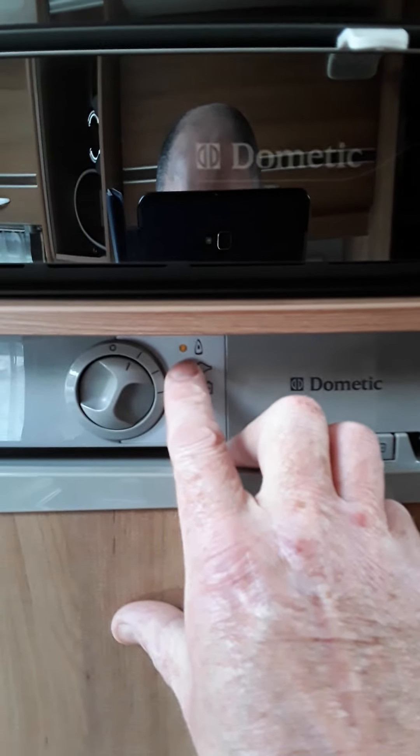Above that you have your oven and grill. You can see it ignites - that's your oven that way and your grill that way - and off in the middle. For your hob, these are just normal gas valves; you'll need an igniter or lighter to light them, you just push them in and out. There's a wee thermocouple safety on each of the rings, so if someone turns the knobs no gas comes out until it's actually lit - that's the safety on it.